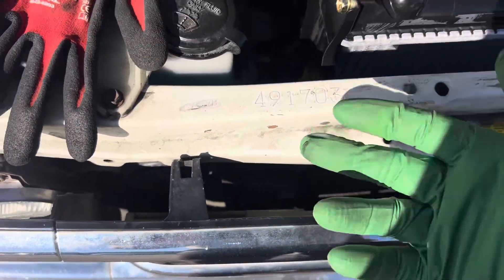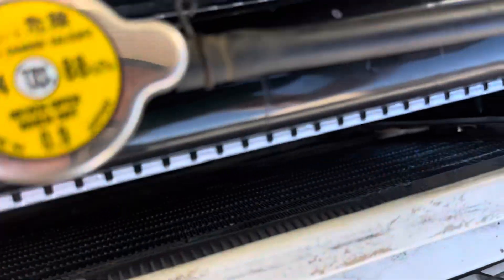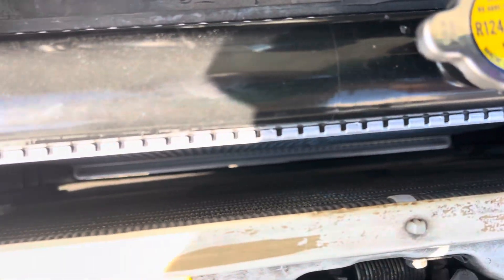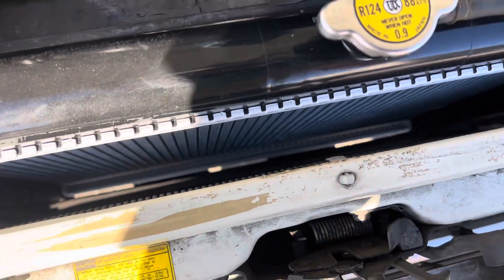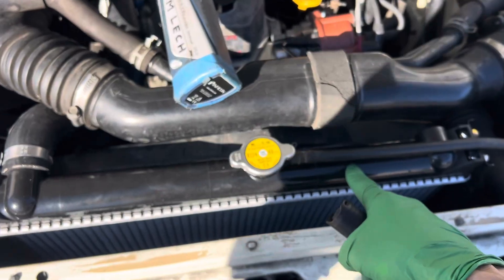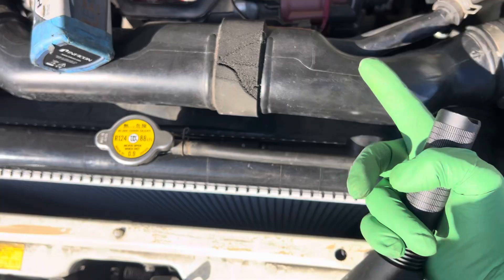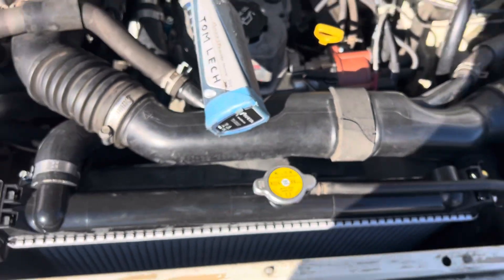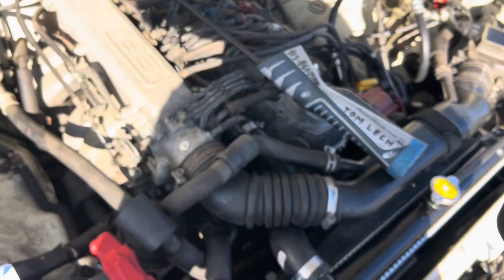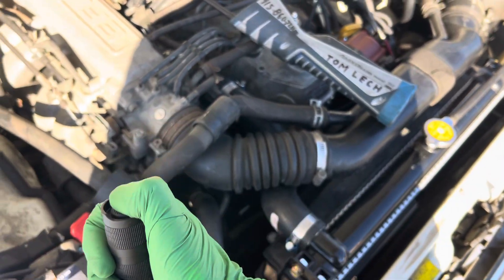This tiny leak shows nothing here, just a little oil film from before. With the UV light, there's nothing there — nothing on the back side of the condenser either. Remember from another video, I mentioned this gap should not be this wide because it's not the original radiator. This aftermarket one has extra spacing that tilts the radiator back more, leaving a huge gap that should not be there — but aftermarket, the good stuff, right?